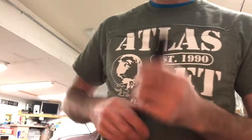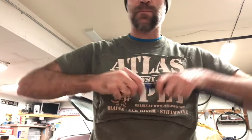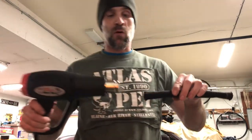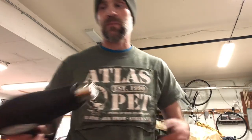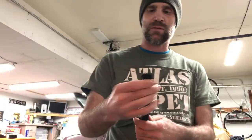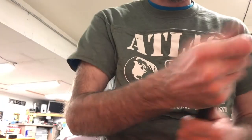I think the problem I've been having is that I need to do both ends of the tube, and the first one turns out fine, but by the time I flip it around and do the second one, the whole tube is getting so hot that it's collapsing from the force of trying to force this through it. So hopefully this is the last tube I'm making. I placed the whole tube with one end stretched in the freezer to cool the whole tube down, and then hopefully that'll keep it from melting when I do the other end. I'm gonna take this tape off and try doing this end. So I wanna heat this up just enough so that I'm not gonna collapse the tube like I did last time.